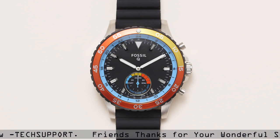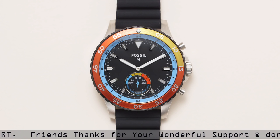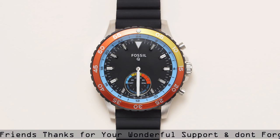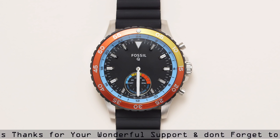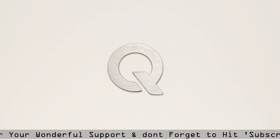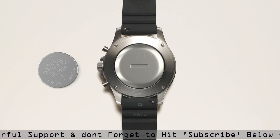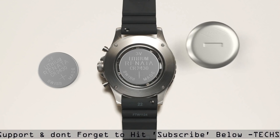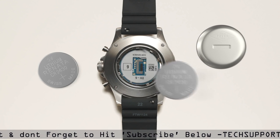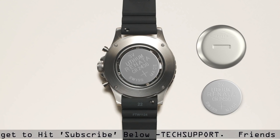There's no charging required when it comes to our hybrid smartwatches. When your battery is low, both hands will point to six as a one-time notification. You'll need to change out the battery every six months or so depending on usage. Use the provided Q tool or any coin and insert it into the back of the watch, turning it counterclockwise to open. Then replace the CR2430 battery, which is available at most retailers.